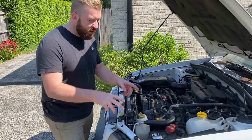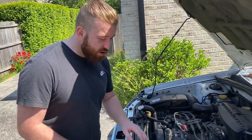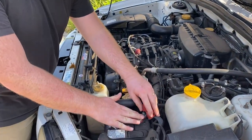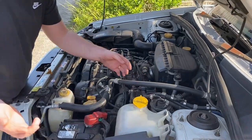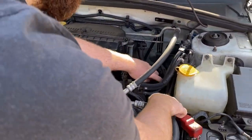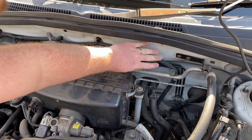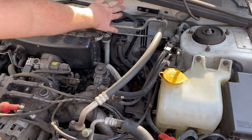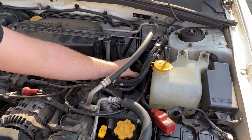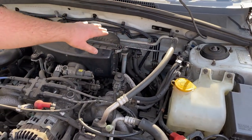We'll go to the car and look at how we're going to do it. We're going to start in the engine bay first and talk through how we're going to wire it up. We need to start with our positive cable, which is going to run along here - we're going to cable tie along this line with the rest of the wiring. Up the back we're going to attach the voltage sensitive relay up here, and in between the positive and the voltage sensitive relay we're going to add a fuse, so that if the battery has a power surge that fuse is protecting it.